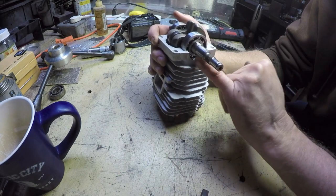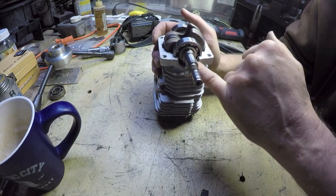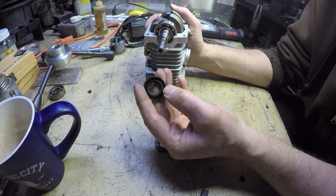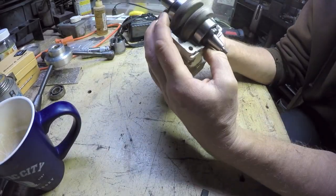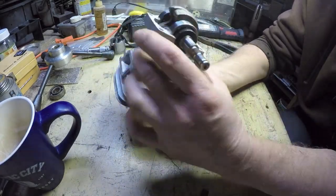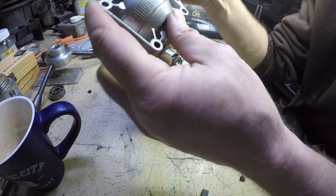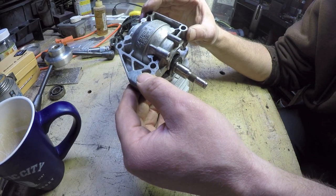I'm going to pull this up out of the cylinder just a little bit and install the seals now, so I don't have to worry about press-fitting the seals once it's all put together. There's a little lip here, and even though the seals are 5mm instead of 4.4mm or 4.7mm, they actually do seem to fit so I'm not worried about that. These seals are a no-brainer as to how they go in — there's an open side where you can see the seal spring. This is the side that faces outward. Next step is putting the bottom of the crankcase back on. I already know the side with the two threaded holes is the oil pump side.